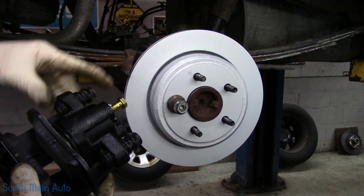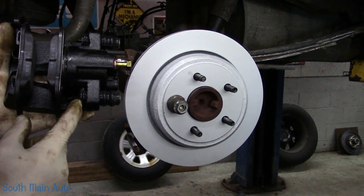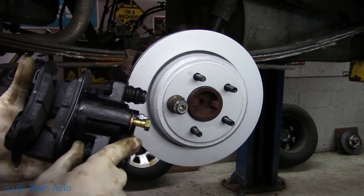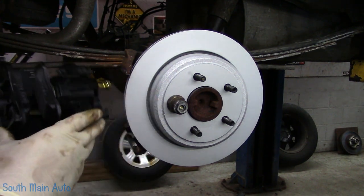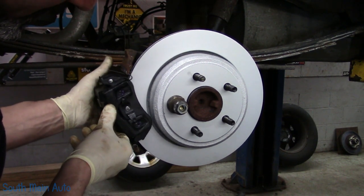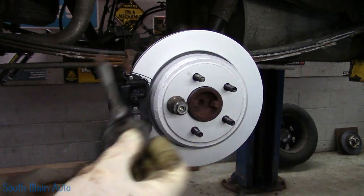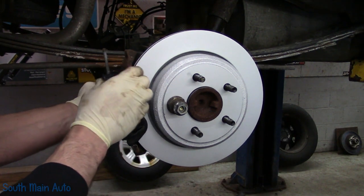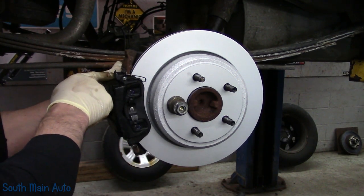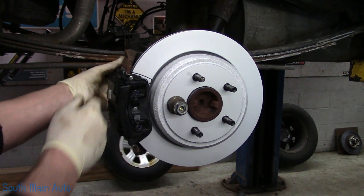Make sure your pins are pushed in because these will snag you up. When you go to put this baby on, if that boot is sticking out it's going to hit the edge on the inside here where the bolt goes and it could tear your rubber. Tearing your rubber is bad — then you've got to get a new one. So we're going to line her up, get her up on the notch, give her a flick. Like a moron, I forgot to put this in first, so we're going to give her a flick back out, get that started, and then get her lined up and get the bolts back in it.